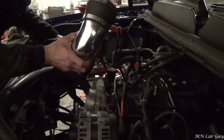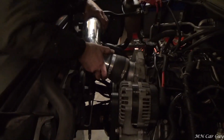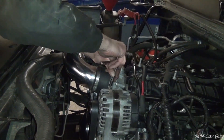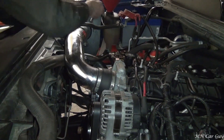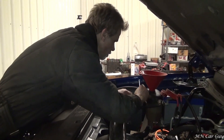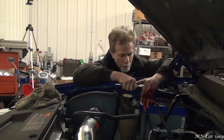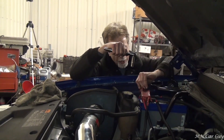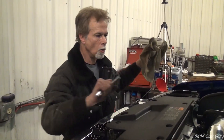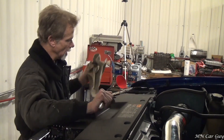This is the final piece — finally after a bunch of work we got it ready for a test fire. We've already done the oil change and replaced most of the coolant. We'll replace the rest of the coolant after we verify there is no leakage in the system. We tried pumping up the lifters with oil but likely they didn't get pumped completely, so there will be noise with those lifters. We're hoping the noise will quiet down after a little while and the engine will smooth out.